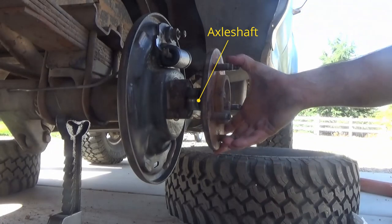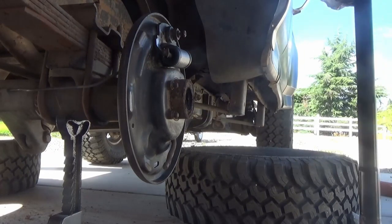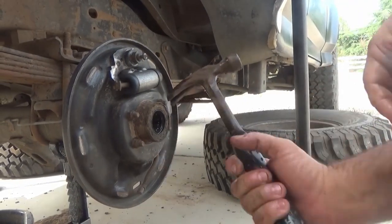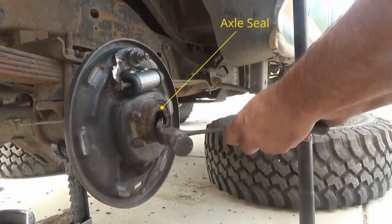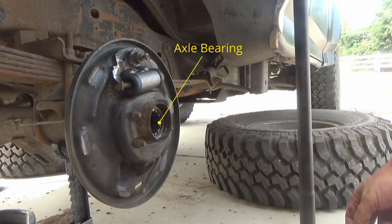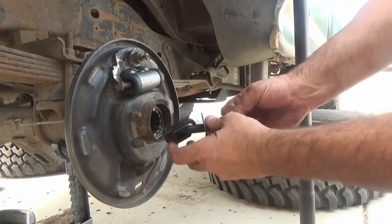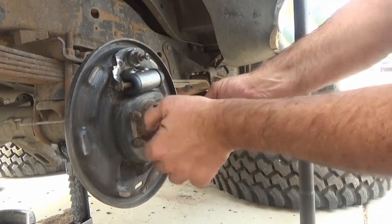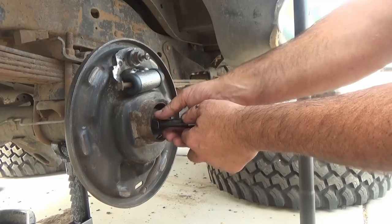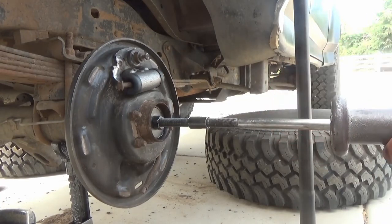At this point, don't rotate the ring gear at all. Go to the outside of the vehicle, grab the axle shaft, and pull it straight out — be careful as it will be covered with gear oil, so use a rag to wipe it off as it comes out. After that, remove the seal using a seal remover tool. To remove the axle bearing you'll need the correct tool, as these bearings are pressed in very hard. The tool reaches around the back side of the bearing, you tighten the nut to sandwich the bearing, then attach a five-pound slide hammer to pull it out.